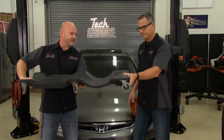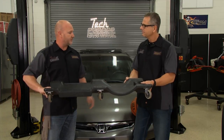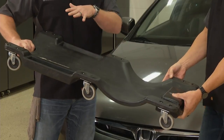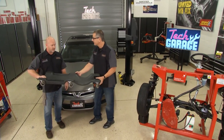Here's a demo. Here's the front end of our creeper — you'll be the front end of the car. As these struts and shocks and springs sag and fade over time, the front end goes down, which is the same as raising the rear end of the vehicle. Again, huge implications when it comes to stopping and handling in all types of conditions. And not only this — this affects ride height too.